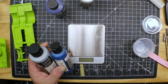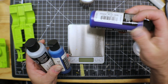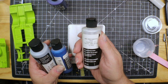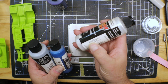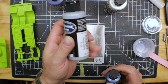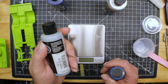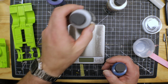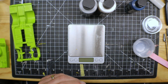But I'm going for a very heavy silver metallic blue. I'm also going to mix up a little bit of the blue sealer first. That way I use less coats of the paint. So what I have here is Cosmic Sparkle 4520 Cosmic Sparkle silver. This is a small flaked pearl silver, and when you mix this with a candy, you get a metallic flake in it as well. It's not huge, but the silver flake in it is a little bit larger than this. They also make a hot rod sparkle, and that's a pretty big sparkle.